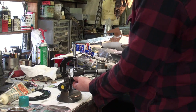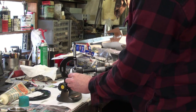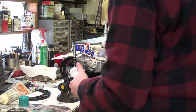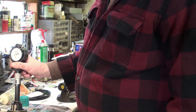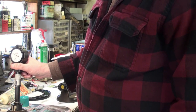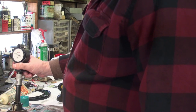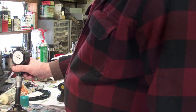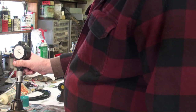And it looks like it's the same, that this crank pin is the same as the other one that I had measured, because this is number 3. So I have that zeroed. And then you take your gauge and you put it in your big end. I have this torqued. Measure that area out. And I'm coming up to 2.5. Two to 2.5 is what is acceptable. The other ones came right out at 2. Well, okay, so it's getting a little closer to 2 in that area. So that's good.